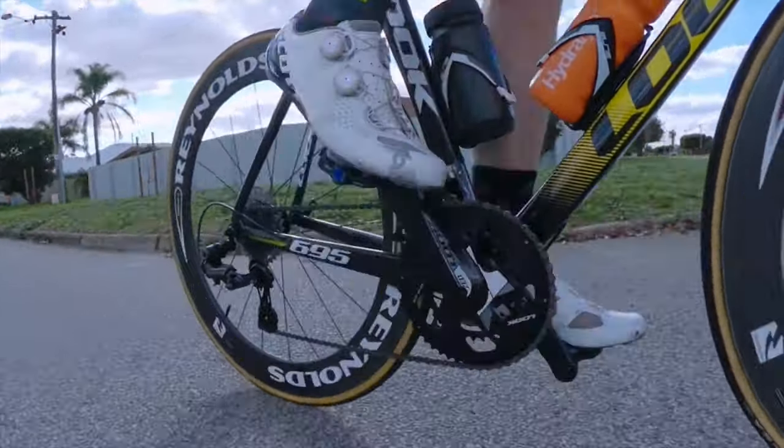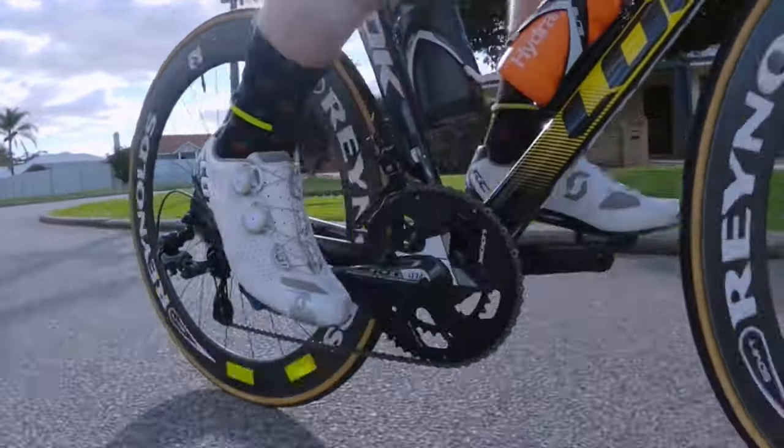In conclusion, here's my evaluation after riding the 12 speed for the last thousand kilometers. The groupset as Campagnolo always does wears in — the chain has really become quiet and the drivetrain is a lot more free. The cassette design is great: they've got single cog steps for the first six or seven cogs and then it jumps two steps, so in the small ring you feel like you've got a lot more gears. You can tune your cadence much better with this new cassette design.